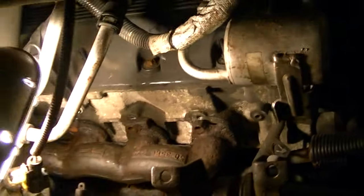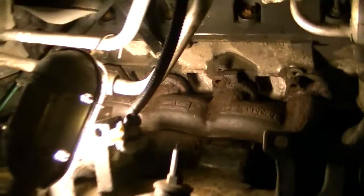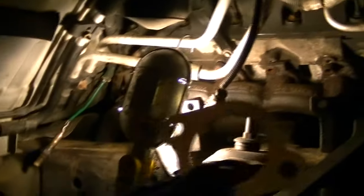I hope I've explained this reasonably well to you guys working on these manifolds. I find that taking these bolts out of the aluminum block comes out much easier when the engine's cold. Make sure once you get a socket on there it fits snug and these will eventually come out. I did put a little oil on the studs but it didn't make much difference — it just kind of made a mess. But they did all come out and I was really excited. The other side manifold is just fine. So let's go ahead and put in my new manifold gaskets. I'll have to set the camera down and use both hands to do these one at a time, tighten them down, and start it up.